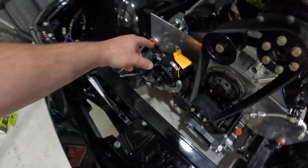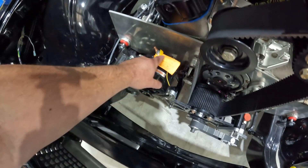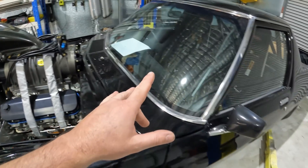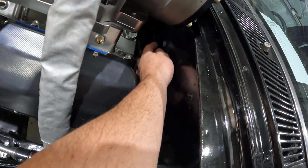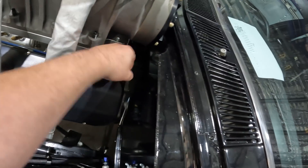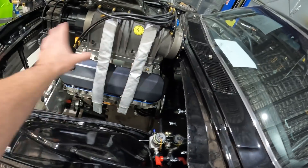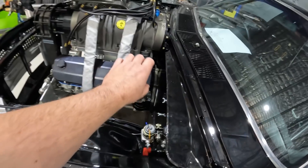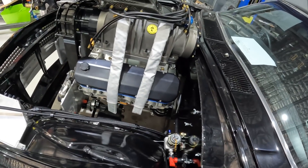For the water pump, if I get the alternator under the crank support I'd probably put the water pump somewhere on the engine plate. It's a bit of a logistical nightmare — like Meccano but really difficult and expensive. For the Haltech, I'm going to run a firewall plug back around here somewhere, so all the engine sensors run through that into the Haltech. Whenever the engine has to come out, it's just a matter of unplugging and all the wires come with the engine.